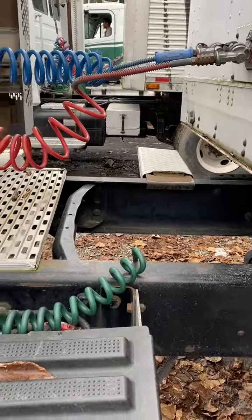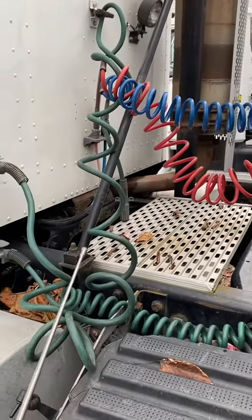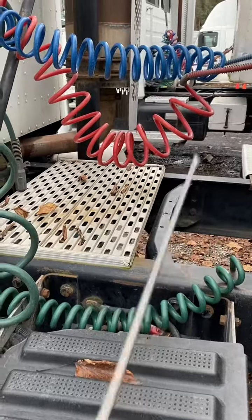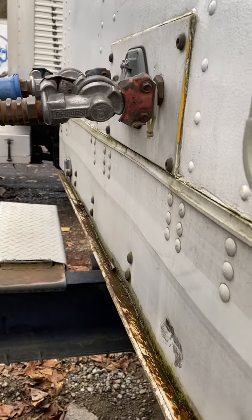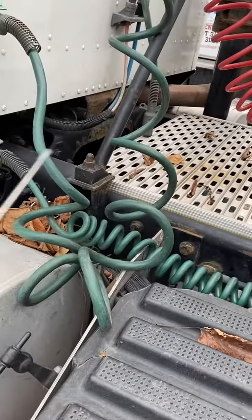To explain all my connections and fittings: from tractor and trailer are not damaged and not leaking. The air hoses and electrical lines are not cut, chafed, spliced, or taped. The glad hands and electrical plugs are firmly seated, locked in place, and free of damage.